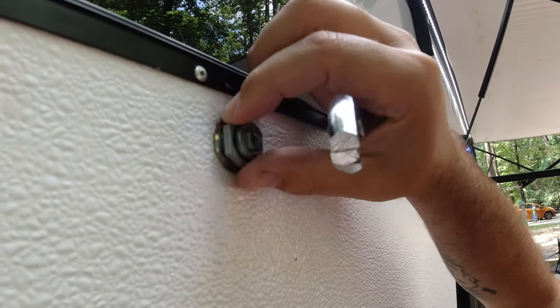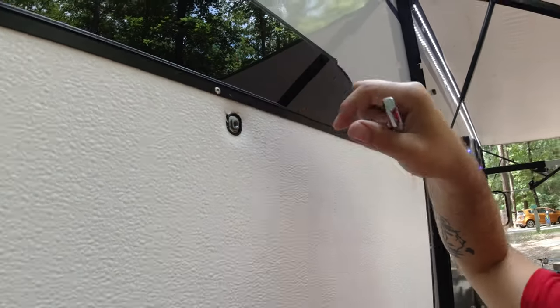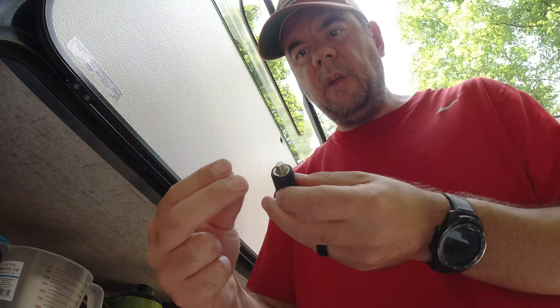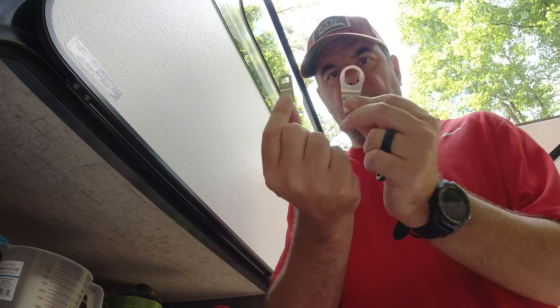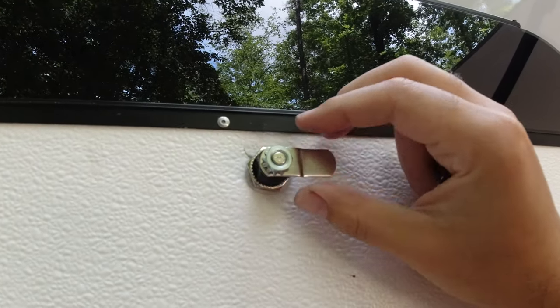You've got a nut here to loosen, take that off, and then your tumbler should drop right out. These replacements don't have a screw like the other ones do — instead, they've got a locking nut that comes down. You've got a seal for the outside, your other locking nut, and then the lock and the latch. We'll get these put on. Now we've got this on, everything seems to work great — close the lid and we're locked. So that's good.